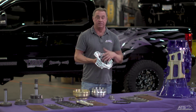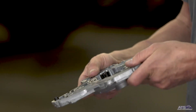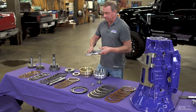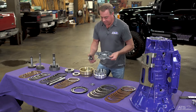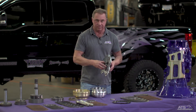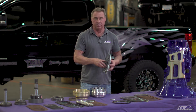Chrysler decided not to put a bushing in the pump, which really needs a nice Babbitt bushing or a bronze bushing. They just machine it as one piece, so there is no bushing in this pump. Considering it's just aluminum riding on a steel pump gear using ATF as its lubricity, it's relatively reliable, but not reliable enough.